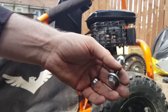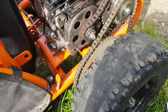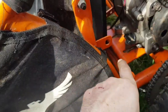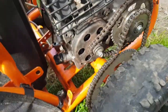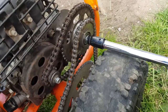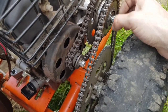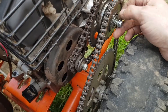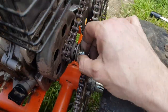I just like to roll them together to keep them together while I'm taking them apart. The washer and the bottom part of the bolt come up through from the bottom. We'll get on to the next one on the other side and that'll be us — we'll be ready to take it apart. Both of the bolts from nearest the seat are totally removed, kept together. Now we should be able to wiggle the engine. I usually like to sit the hardware upside down in a tub so that they can't get lost and they stay the way they're supposed to be.